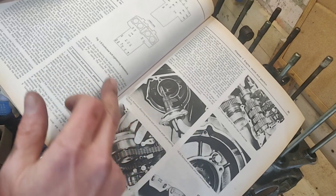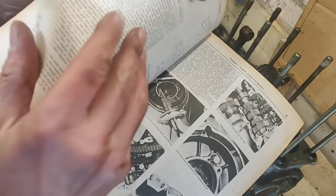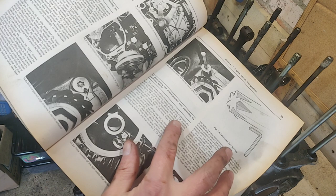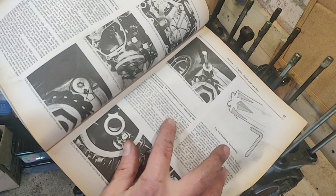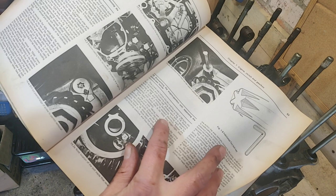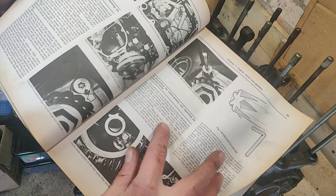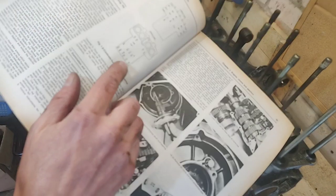For putting it back together, because it does say, there's the little map as usual, crankcase secured by 38 bolts, fuck me, bolts shown in figures 9.9 to 9.1, starting with the upper crankcase, which is what I've got. Slacken each bolt in sequence by about half a turn at a time to prevent distortion. Repeat the sequence until every bolt is no more than finger tight, and then remove completely. So just start at 38 and work backwards. So 38.